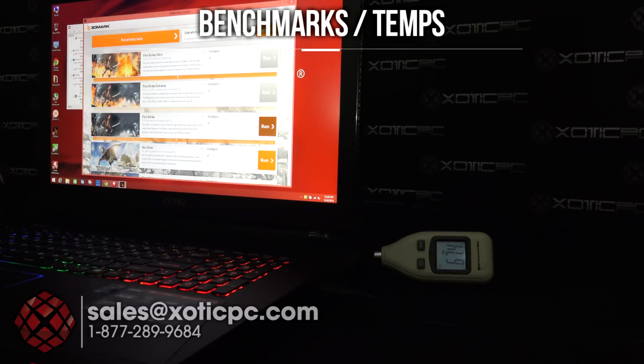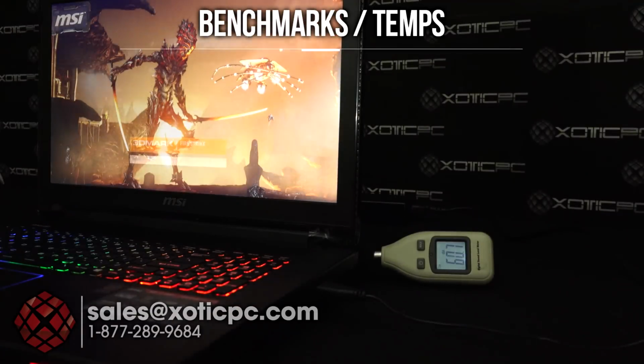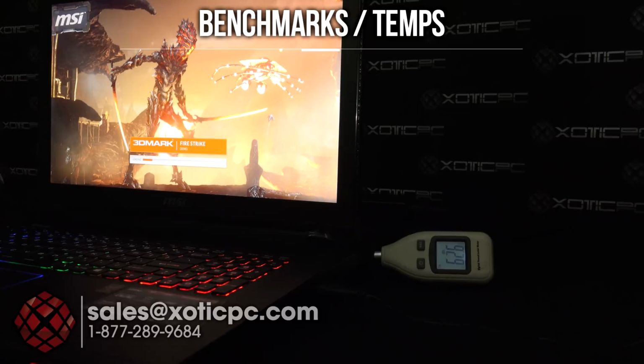We're going to start off with 3D Mark Firestrike. As you can see, our decibel meter is set off to the right hand side. That is the GPU exhaust. So we're going to listen to the fans as they ramp up while they get under load. Also put this microphone down over there too so you can hear the fans kick up as well. Have hardware monitor running in the background, so we'll check out temperatures after it's done. And we'll also be shooting our FLIR thermal pictures and overlaying that so you can see where the heat is generated. And of course we'll go over the results and see how those compare to where they should be.